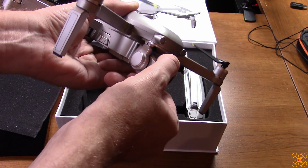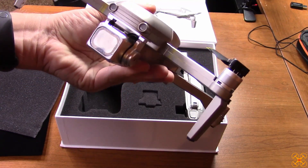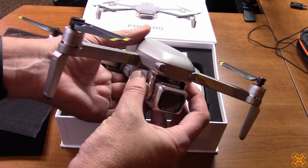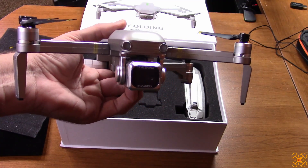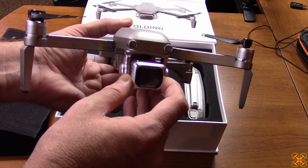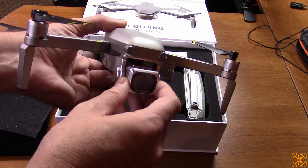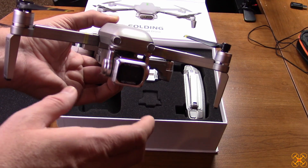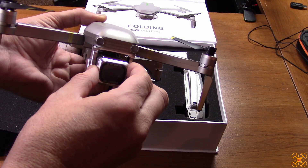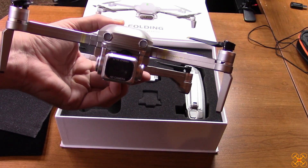The camera actually butts into the body of the drone so it can't tilt very far. They advertise 4K, but according to the specs on Banggood it does 1080p at 25 frames per second. The 4K is probably just for photos. They also mention self-stabilization on the camera, but since it's servo-driven and can only go up and down, there's no three-axis or two-axis stabilization — just one axis. I don't believe it'll do more than let you tilt it; we'll see at the test flight.